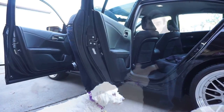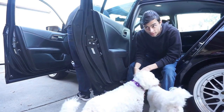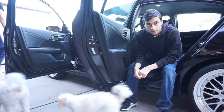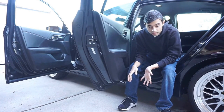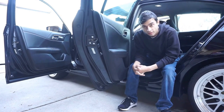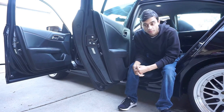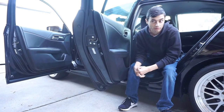This whole time all I've been doing is holding the camera and the door part. This time I'm actually not doing anything — emotional support. So next up is the driver's door, the opposite side of which we just did. It's going to be literally the exact same process: take the door card off, unplug the old speaker, plug in the new one, do our little fabrication, make sure it works, and put everything back together. It's both really simple and it can be complicated if it is your first time. Luckily we know how to take this door apart and have done speakers before — everything becomes easy the more you do it.